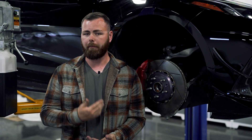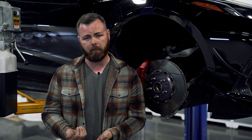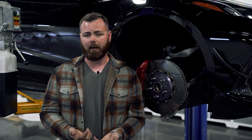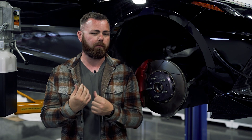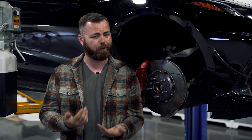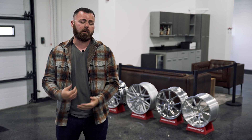Martin, you asked how to bleed the brakes on a C8 Corvette. You can do it the old-fashioned way pumping the pedal, however on this car you have to disconnect the battery first — if you leave the battery connected the car goes into limp mode and you won't be able to drive over 45 miles an hour, and you'll have to go to a GM dealership for a relearn. We advise either disconnecting the battery with a buddy helping, or using a pressurized pump system to push fluid through the brake calipers. You can pick those up cheap on Amazon. If you're worried, just go to your GM dealership and they'll do it for you.